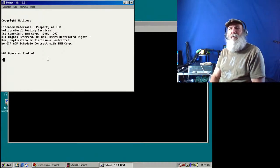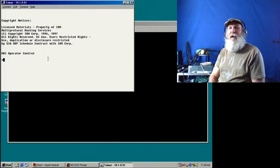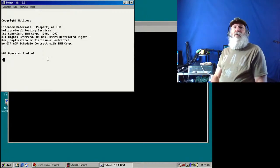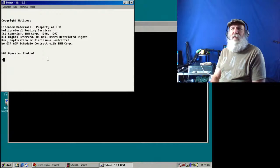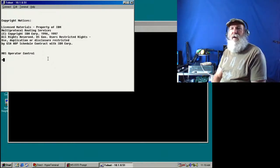really knowing how it's routing and hitting those things. Now, because really on the network setup of the ThinkPad that I have now, it should know that all the addresses that aren't on that local subnet are accessed through the gateway. Really for the connectors I'm using, on the ThinkPad, I have a PCMCIA token ring adapter, and that's going through to my hub, to my 8239 hub.